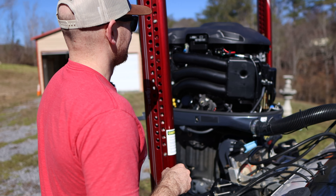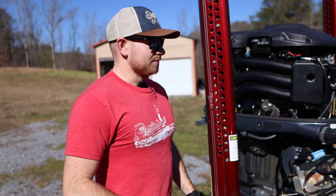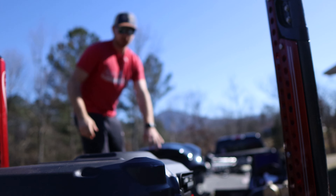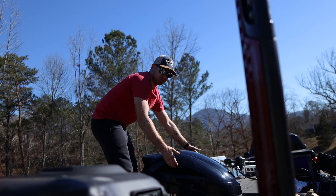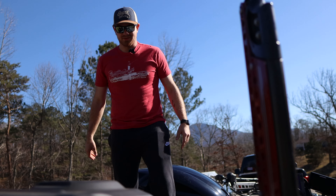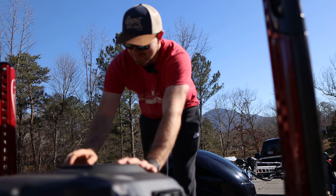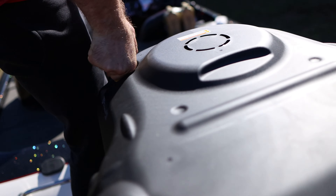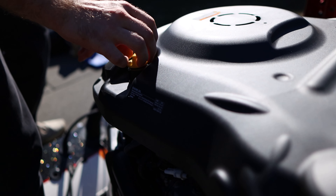Next step — TJ says dump in some oil, and really, should we? Yamaha calls for 7.1 quarts; we're gonna put about 6.7 to 6.8 in there and see how that goes. After we run it on the next fishing trip and get back, I'll check it. The old cap is right here — my hands are all slippery — there we go, just like that.